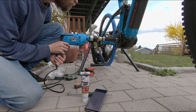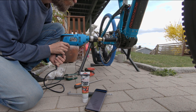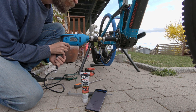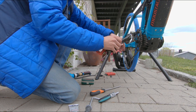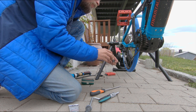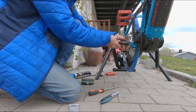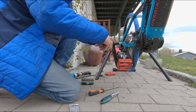When we know that, we can turn on the bike to determine the power amplification at various cadences and assistance modes — or so we thought. We're using the 2020 Bosch Performance CX Gen 4 motor and it is not activating. If I push the other crank arm with my hand the motor engages, so I push it and quickly start the drill, but there's no motor resistance — it's just cutting out. Is the power coming from the drill too even? After a lot of testing, I have to say this is a fail. It could work with other motor brands, but I haven't got one to test at the moment.